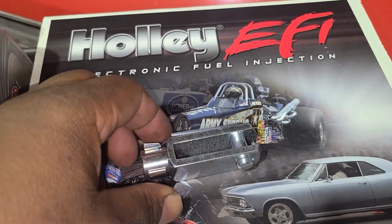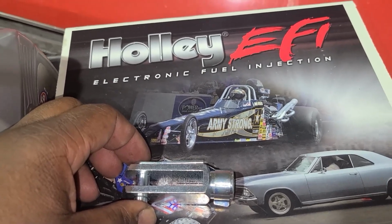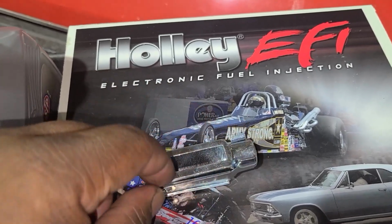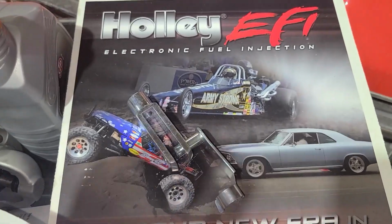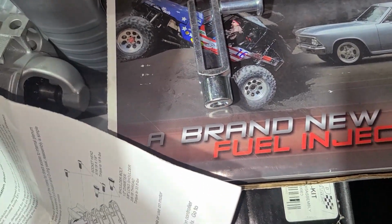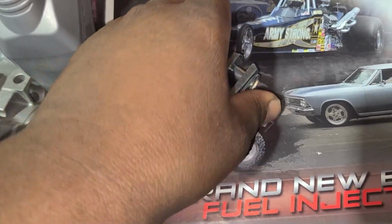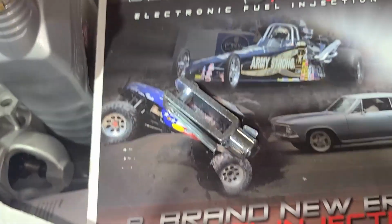So this is our clevis that screws onto our rod coming out of our Hydroboost unit. So I just wanted to show you this. It has a special clip that retains the pin. So let me open this up so you can see. So it works like that. You pull the pin out and it will go back in. You place that in and then clip it back down on there. So that's how it works. So let's get our clevis adjusted.